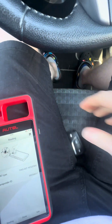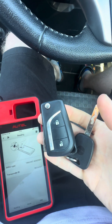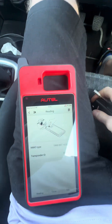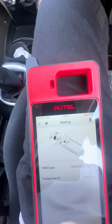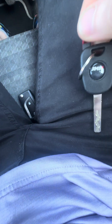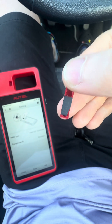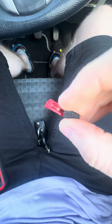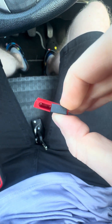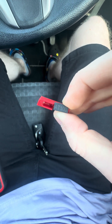So that's perfect — cloning an 8A chip for Toyota using the KM100 and the AT100 transponders. Like I say, this chip was used to clone an ID46, so they are overwritable as well. Can't reset them like the superchip, but you can just overwrite it.